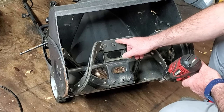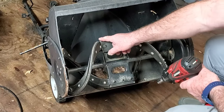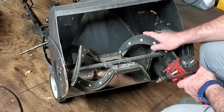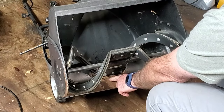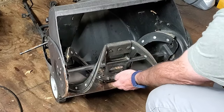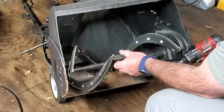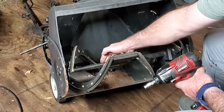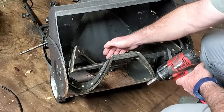It's still going to pull snow in if you have three or four inches. But what really makes these not work very well is when this center piece gets worn down so it doesn't contact back here. It needs to be really close to this back wall — it doesn't actually need to contact it, but it needs to be really close. As these wear down, it gets further and further away.